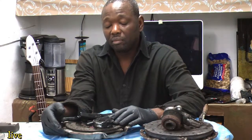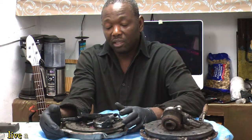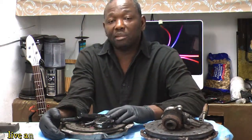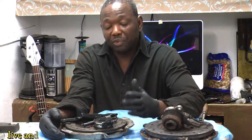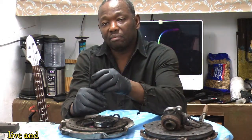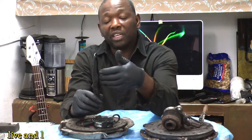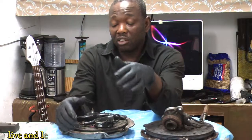On the Subaru, the customer came in saying the clutch pedal was sticking to the floor. The first thing I checked was the master cylinder — it was no good, so we changed it. But we still had the same problem. On further diagnostic, we found the fork was leaning to one side on the transmission, and when you pressed it, the fork was going sideways instead of straight.